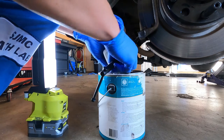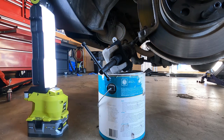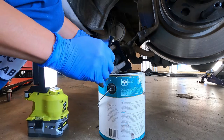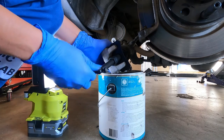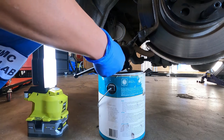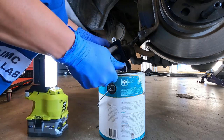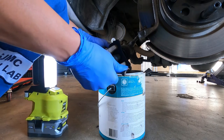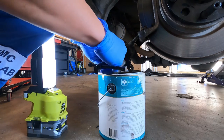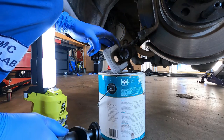Make sure this is nice and tight. I'm going to step away to check the brake fluid from the reservoir — the brake fluid looks good, nothing is coming out. We'll continue to turn this, and once it reaches the very end you will feel it stop. Continue to tighten it nicely. You can tell I can't turn it anymore because the piston is completely retracted back. Now we'll loosen the tool — you have a fully seated piston.